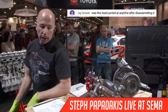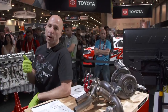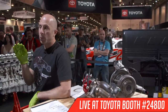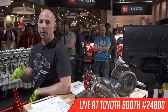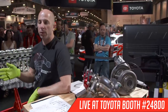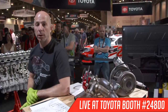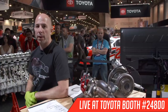There's a couple questions we didn't get to yesterday. One is whether the dual exhaust or the integrated exhaust manifold is a limiter. At lower horsepower ranges, 700-800, I don't think so, especially at lower RPMs if you're trying to stay below 7,000. If you're trying to make power at 8 or 9,000 RPM and make 1,000 horsepower, it could potentially become a bit of a limiter. We're not there yet. We're going to see what we can get out of the 2-port exhaust head and then go from there.